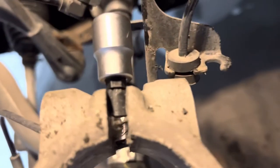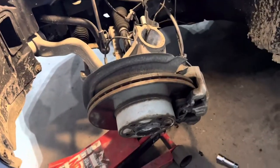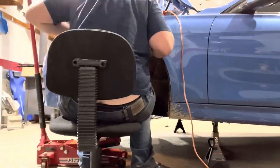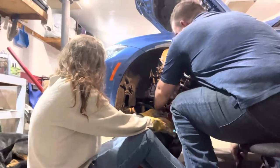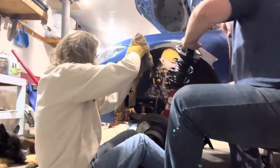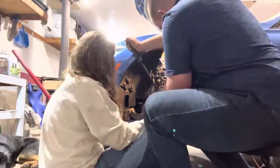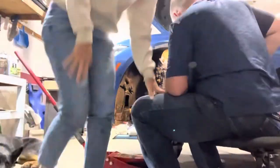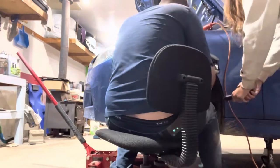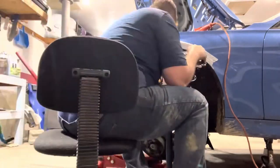So now I've got the spreader socket back in its place, opening the hub with the shock going in. Remember when I said you didn't want to get caught having to use a chisel and a hammer? Well, here I am hammering away. The unfortunate thing is that spreader tool was just not thick enough to help me get the new struts in — they're a little thicker than the old ones. We pried against it, hit it from the top, taped a hockey puck to the top so the hammer wouldn't damage the strut mount, and boy this took several hours just to get it in. I finally figured out there was a chisel I could hammer in there and use in place of the spreader tool. I ended up putting masking tape on the fender because we were in there with so many tools. It was a bit of a nightmare, so hopefully the other side goes better.